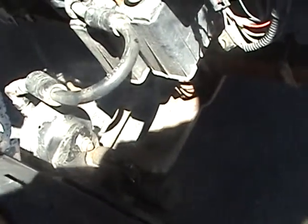Well, Tom, how do you check the slack adjuster? Level ground. You chalk your wheels. Go in and push the emergency brake on. Come back. Pull on the back of the slack adjuster right here. This is your slack adjuster right here. You pull on that. If you pull more than an inch, it needs to be adjusted. Okay. And basically, that's the engine check.